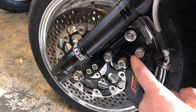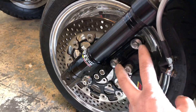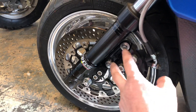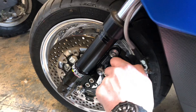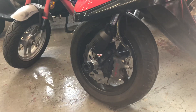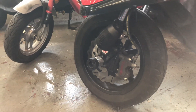These adapters are not generic — there are a ton of different adapters in different sizes. For example, these are RGS legs for Zuma 125 and the spacing and fit on this is different between OEM and RGS. They're all a little bit different. So when you're doing brake stuff, just go with what works and what's simple, because if you start mixing and matching a bunch of stuff it can be a pain in the butt.